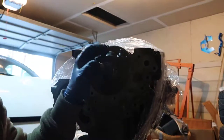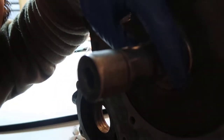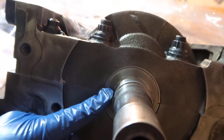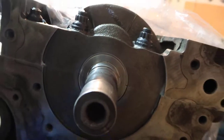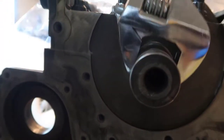All right. So first thing I would suggest is get the engine, and right here the crankshaft has these two little parts. I think you can see one is right there, a little straight part, and one is right here. It's like a missing part of the circle, right? There's a circle, here is a straight, and here is a straight. So if you get a wrench like this, you can turn your crankshaft.